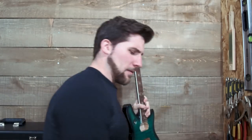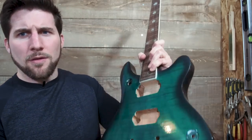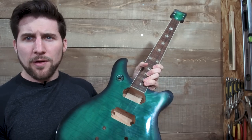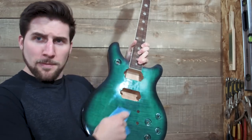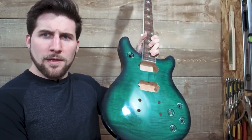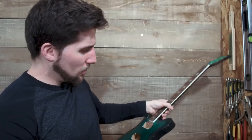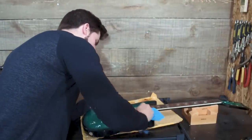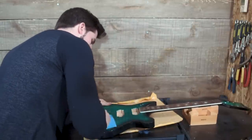Now when I go in — even with something like a shop towel — and buff this off, I'm going to have to change the angle on my camera here. So all gross and swirly before — and see, nice and glossy now. Hazy, then glossy. So that is a protective option for the clear coat. And if I go in and buff all of this out, even with this shop towel, I end up with a nicely protected gloss finish.